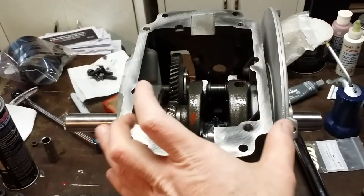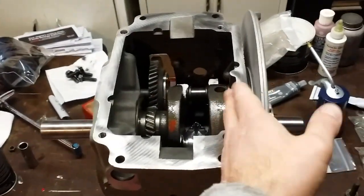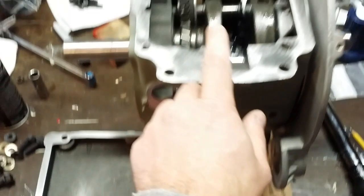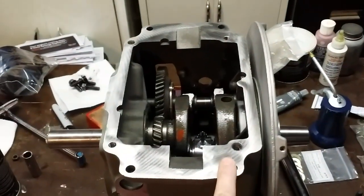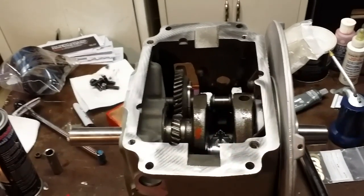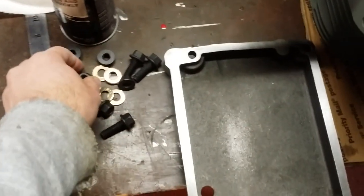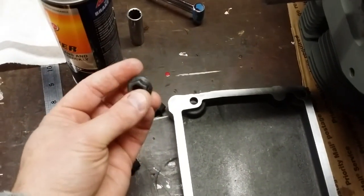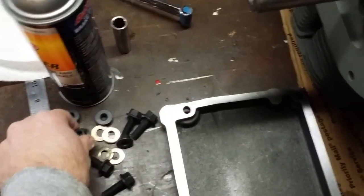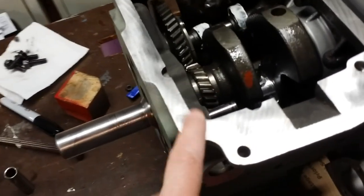When I put this all together and am just about ready to torque it, I'm going to shift the oil pan as far as I can in that direction to maximize clearance. I'm going to torque the oil pan bolts — the actual bolts that hold the oil pan on — to the K-series specification, which is 260 inch-pounds, or about 21½ foot-pounds; I'll round up to 22 foot-pounds all the way around. On the outboard ones I have locking nuts so they don't loosen up — I'll make them snug and give a little more. I'll also blue Loctite the actual pan bolts in the block.